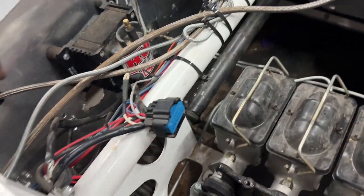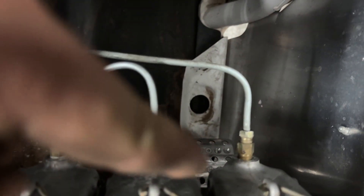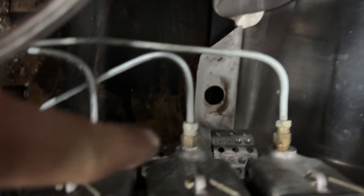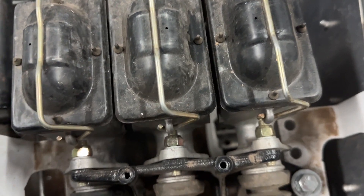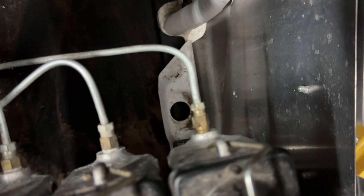I did a bunch of work inside the car. I moved the whole brake assembly and clutch assembly back. On the brake pedal itself — that's the clutch right there — you see those screws, you can move it one way or the other. The brake was the opposite of that way, and I moved it to the same way the clutch is, so that moved over to the left a little bit, and that helps spread your feet out. I like my feet spread apart. I'd like to run it like Bloom Quest said he did — brake outside, clutch inside — but you can see where the clutch is, it's above the frame rail, so your foot would have to sit on the frame rail. So that's definitely not going to happen.